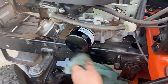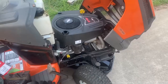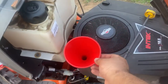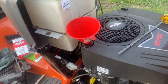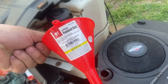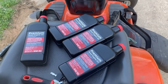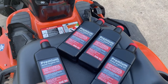On the filter side I'm going to do the same thing. Now we got all the oil drained out and everything put back on — the filter and the plug. Get your little funnel — you want to put the oil back in. So we're about to put two quarts in here. I got these little funnels at Harbor Freight, four-piece set. Little tiny one and I think this is the biggest one, like 99 cents.